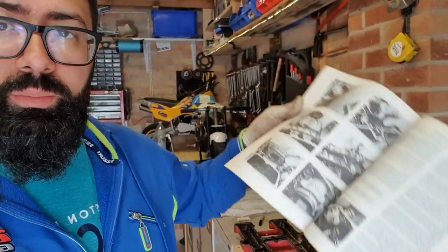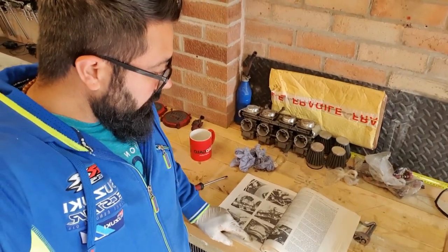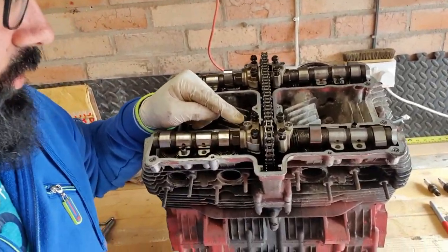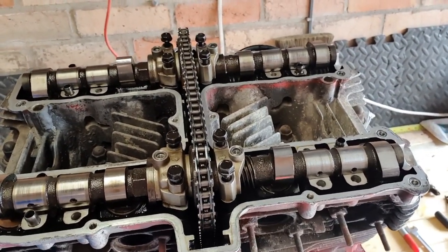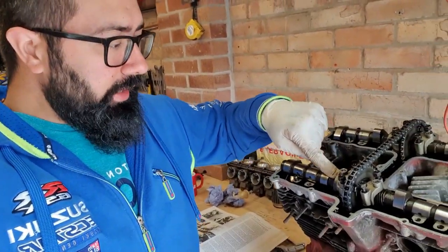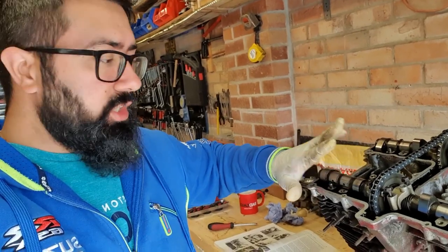All right, guys, so after a bit of reading and looking about in the manual, down here on the reassembly bit, it says that the crankshaft should have a mark in there. Not sure if you can see it. It's supposed to have marks to indicate top dead center, which I cannot find. So what I did, I got the center caps and placed them back in the engine on the crank. It's only loose, nothing is under pressure,